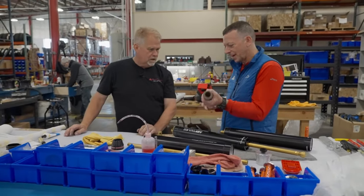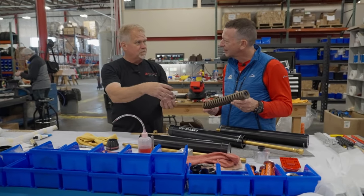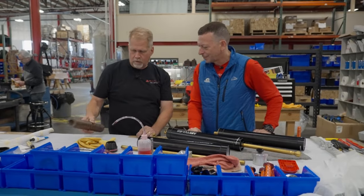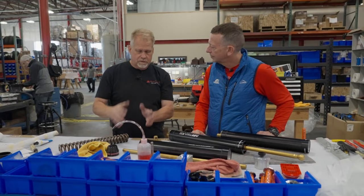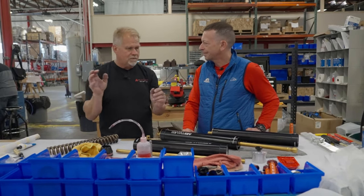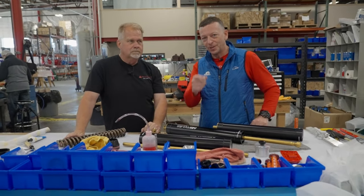I remember our first spring was shorter and bigger around — our damper was about this long with the cage down here. Then we did a spring inside a spring to make a dual rate, which worked really well but made it heavy. We had to go back a little on performance, but in the end we actually got better performance than we had before. We're holding roughly 2,000 pounds gross weight with barely a quarter inch of sag, and we have more available up travel than the competition. We have a 60/40 rule in suspension — we try to stay within 60 and 40 percent of travel at ride height gross.